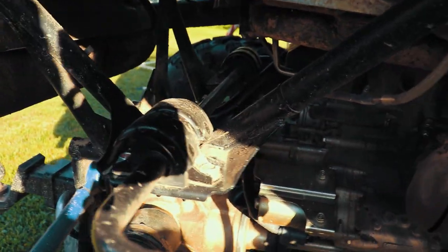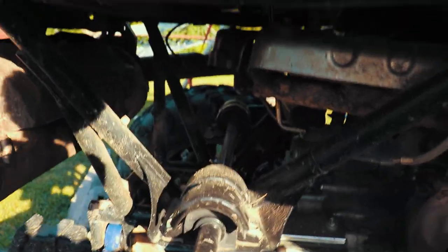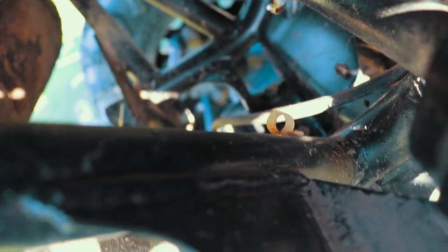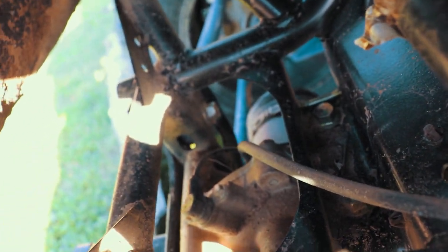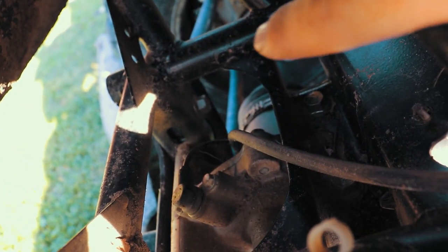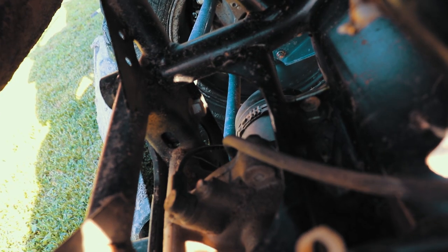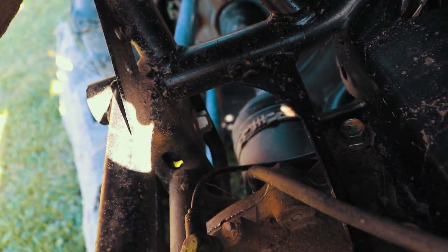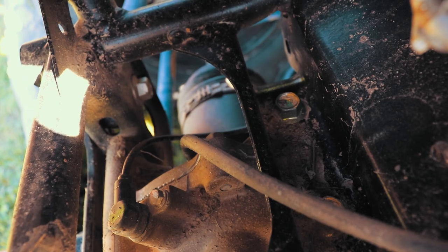All right, your back one is gonna be this rear differential here, okay? And you'll be able to find the hose for this one is right here. Get the camera back there without breaking my lens. All right, so this one right here, real close to the camera, is actually the vent line. Let me focus. So that's gonna run down onto your back differential. And I'm on the passenger side, back tire looking at this.